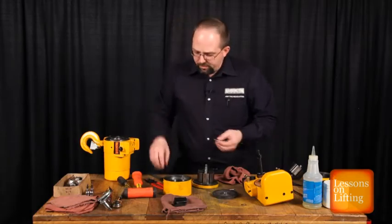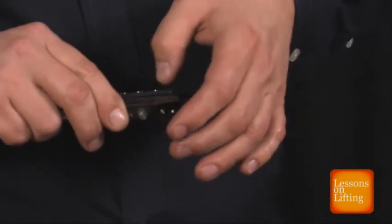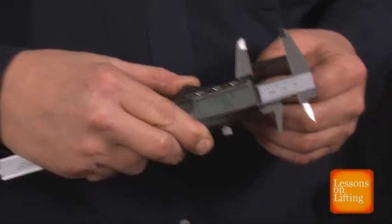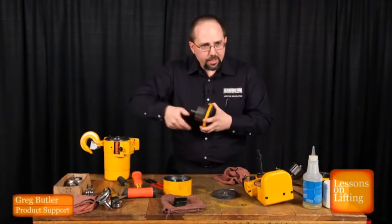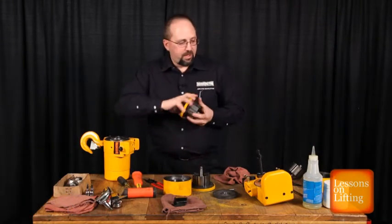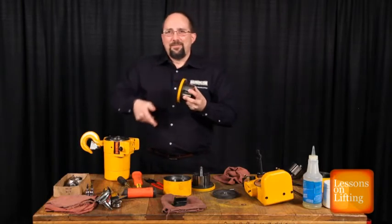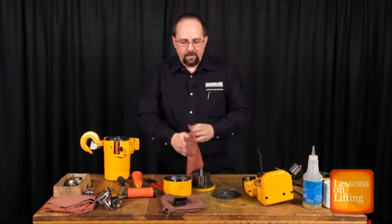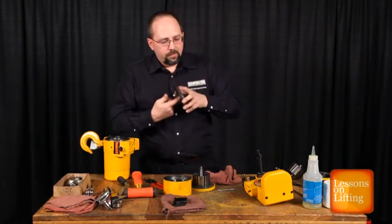If you want to measure your vanes, the criteria on the vanes is going to be 25 millimeters. This one here is 26.67 millimeters, so we're in good shape. We want to inspect the bearing in the rear plate and make sure it's smooth. I have a bad one here so everybody can take a listen — if you hear a whirring noise, you need to replace the rear bearing. Inspect the bearing in the front plate — that's smooth, no roughness, no play.